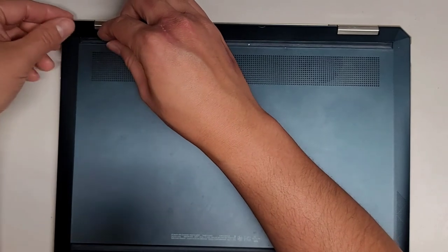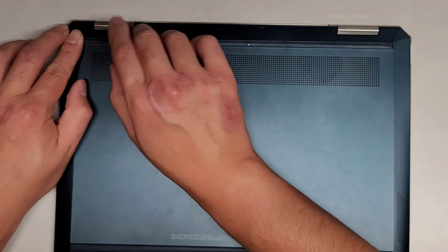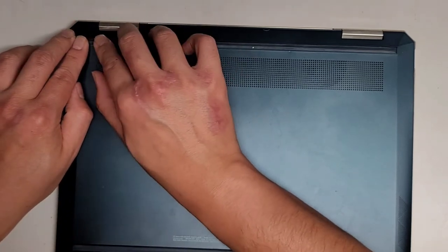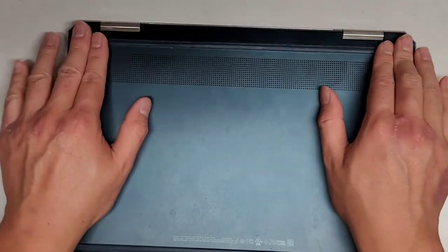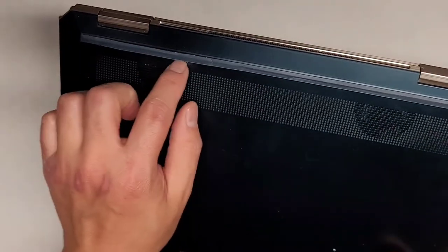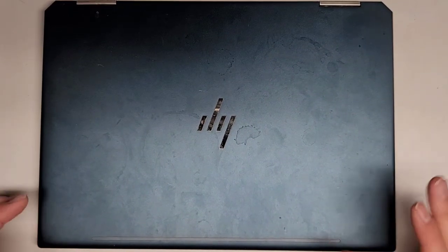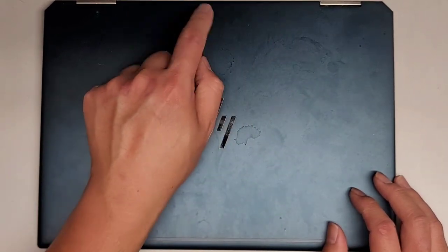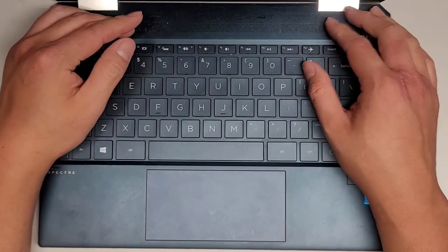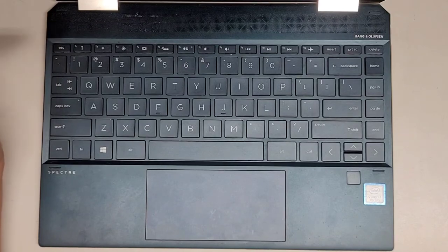This one because it broke is going to be weird — let's try and get this side in first and then hopefully push it down to even it out. The rubber's not really sticking to that adhesive well, so it's weird shaped — can't really do much about that. That's pretty much it. Hopefully this video helped you guys out at least to open it up. You can upgrade the SSD, change the battery, the trackpad, and the four speakers. You do have to remove the motherboard for some parts, though the power button probably has just one screw. Anyway, that's pretty much it — thanks for watching, I'll see you on the next one.